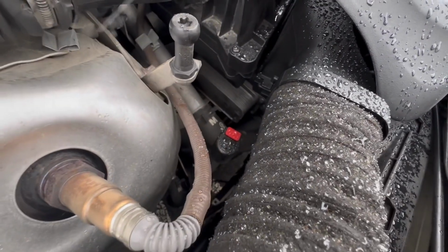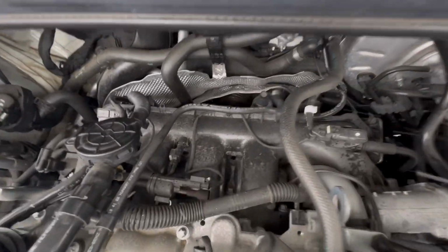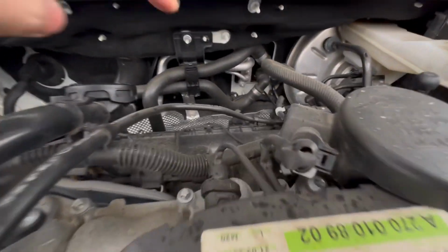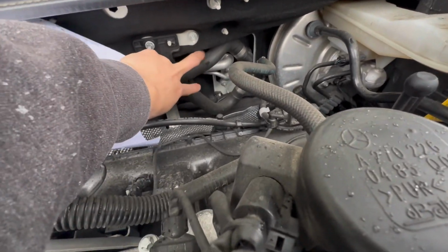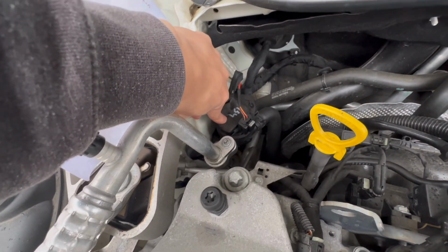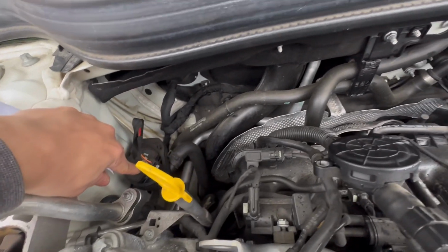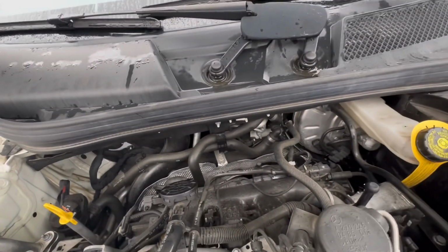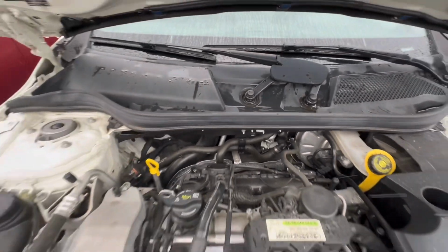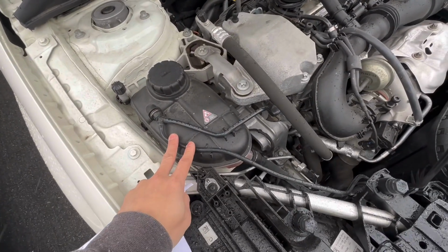They have the oil cooler there, and the thermostat is behind. The engine is under the intake here, and over there is the heater core. This is the hose to the heater core, and for the heater core they have an accessory water pump. This pump helps the inside of the room get hot faster, and this hose is kind of a vent hose.